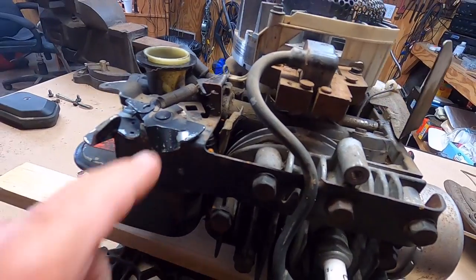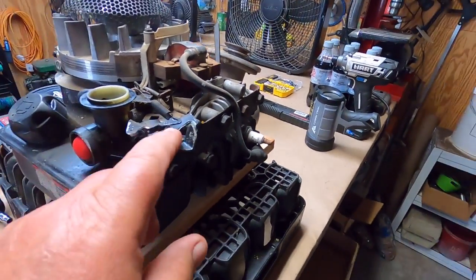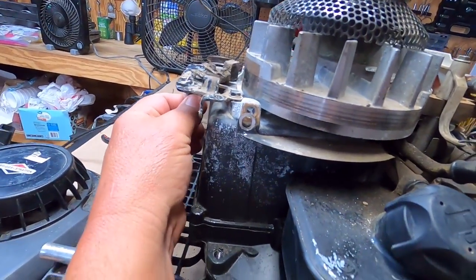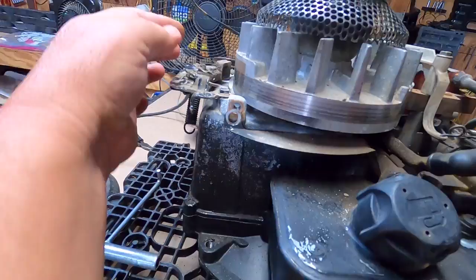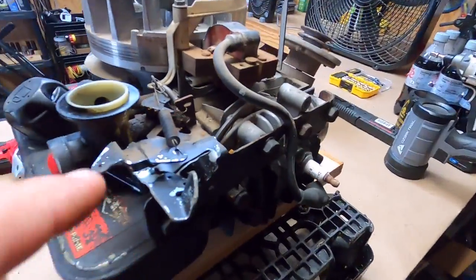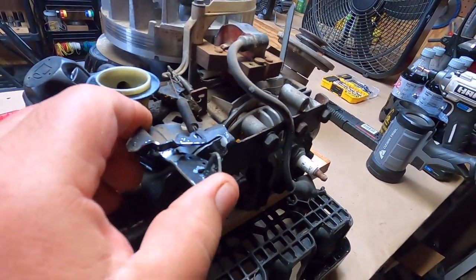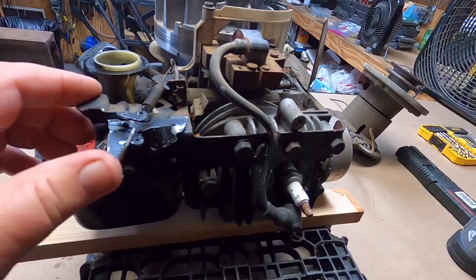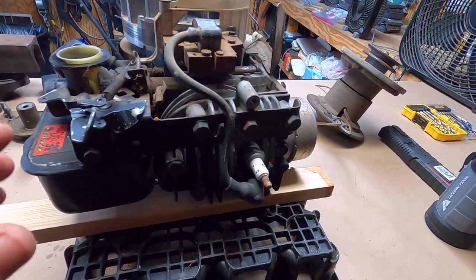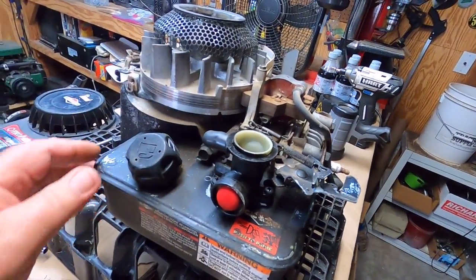That may be a problem if it is, but I'm not sure. On this side I've unhooked the brake assembly, and this is the kill switch — this is where the kill wire goes. I need to move this to that little square hole down there so it'll shut it off. I think I'm going to bend that up so when you go full choke it'll shut it off.